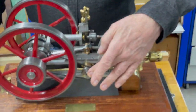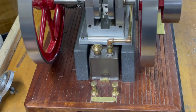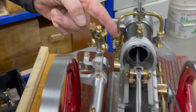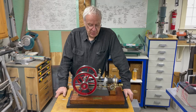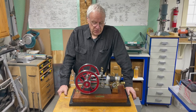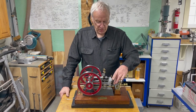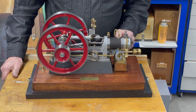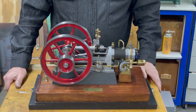I like to put in a pump. Underneath this engine I have a tank that has the cooling liquid in it, and it seems to work pretty well. Over here I have a little gap in the cooling system so I can see that the water's running when the engine's running. The advantage of this type of cooling system is it's self-draining. When I shut this engine off, over a period of time all of the coolant will run out of the cylinder and go back down into the tank because it's not overfull. That way, if you had any leakage, it wouldn't go into the cylinder — and it's worked very well.